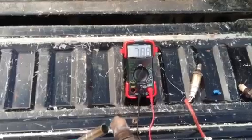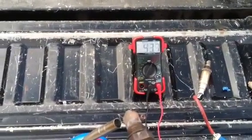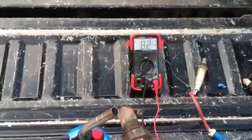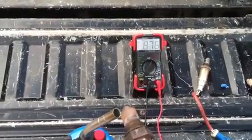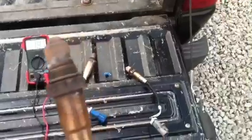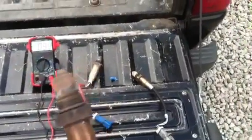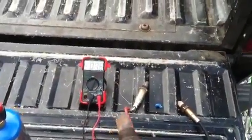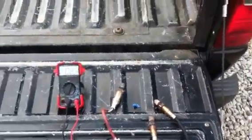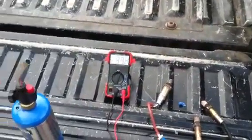We'll get all the way up to 0.8. I'm just going to make sure it's in the flame. There it is — 0.87, I saw. Which is good; 0.85 is good. So all three of these oxygen sensors work, or at least the sensor in them swings back and forth whether it detects oxygen or not.